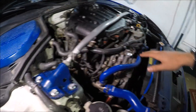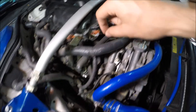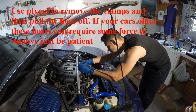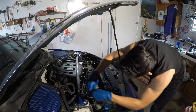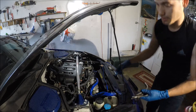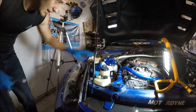Once the engine cover is removed, you're going to unhook the hose from the manifold — get pliers on the clip, pull that hose off. Then get to the other hose at the PCV valve. Now you have the PCV valve exposed, and as you can see there should be oil in here — this is where the oil blow-by is coming out of.